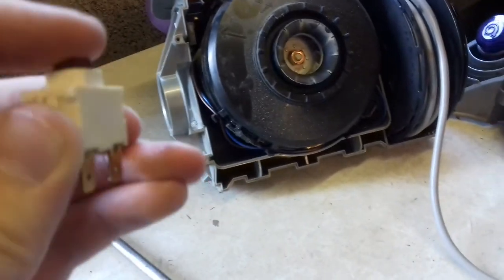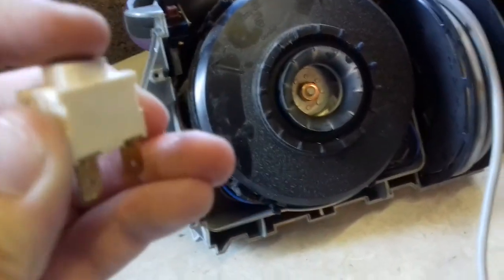The switch is fitted - feels fine. The old one works most of the time, but then you see it gets stuck and is a bit useless. The new switch should work - no reason why it wouldn't, because the Dyson it came from was a 1400 watt motor in an upright, and this is a 1400 watt cylinder. They are very similar motors as well, so I don't really see why there would be any difference at all.